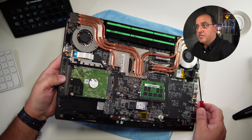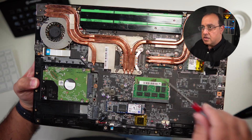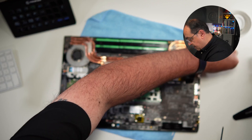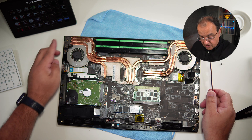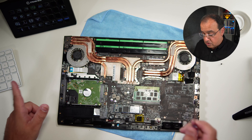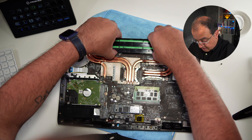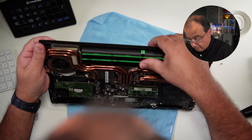If I lift that up there you'll see there's a screw — so we're going to unscrew that. I've kept all the screws together. One thing to watch when opening your laptop: make sure you know which screws go where. In my case they're all the same, but if not, place them on a piece of card mapping the position — top, middle, side — because some screws can be longer or shorter on different machines.